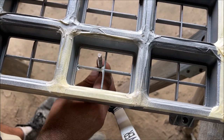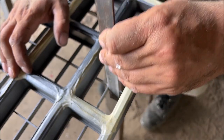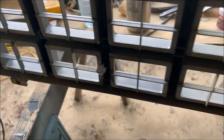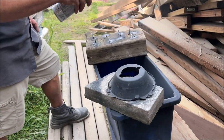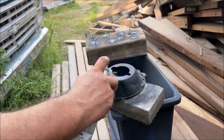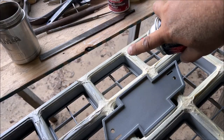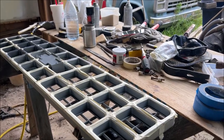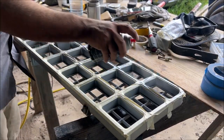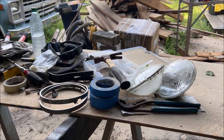Both repairs are done. Now we have to sand that JB plastic weld off — try different things to clean these up. Remember to flip the grill around; it might be easier to sand from the back. We got the repair done right there. With a light coat, we went back and masked the grill off, and now we just paint every square on the inside.